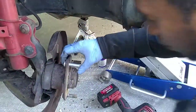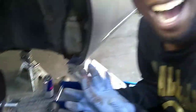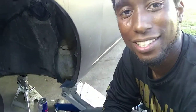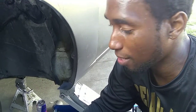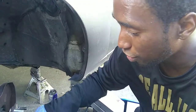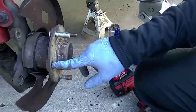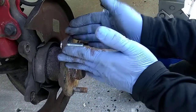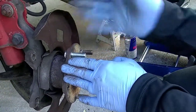So we've got a little bit more to go but I'm going to get that in there. And how I'm going to do that is I'm going to put the rim on — but ow, it's hot, it got me. So that is how you replace a stud on a bearing. Now not all of these are going to be the same way. Some hubs are going to have the studs built into them and you can still change it out, it's just more of a pain. Just make sure you try to line up those grooves as much as possible, because if you're in between them you'll start to see it spin. This is going to sit a little bit cockeyed — sometimes you want to make sure that it's straight, because if it's not straight you're not going to be able to get the rim on. It's going to bend and do all types of other stuff.